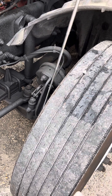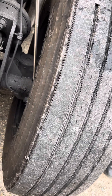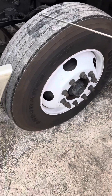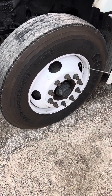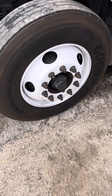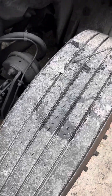Then we'll come to our brake components, which will be our brake drum and brake lining. We're going to make sure they're not cracked or broken, and free of any dirt, oil, or grease. Then we'll come to our steer tires — make sure they're properly inflated using a truck tire gauge. Make sure our valve stem is in proper condition, the cap is hand tight and not leaking, and there are no cuts or damage on the tread on the inner, upper, and outer wall.